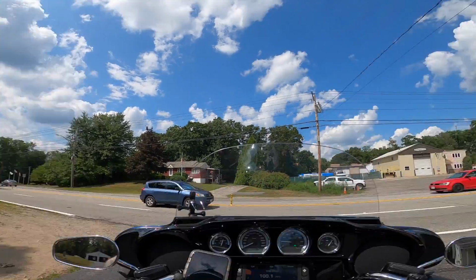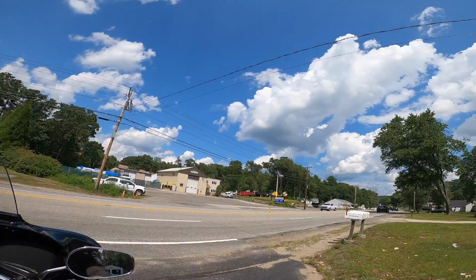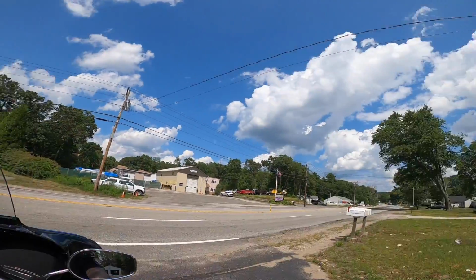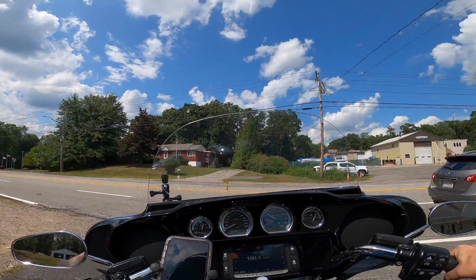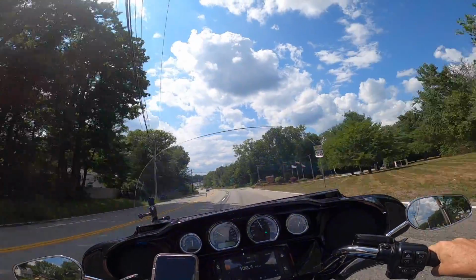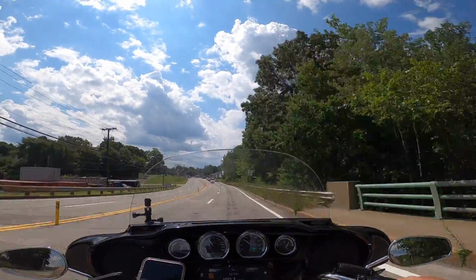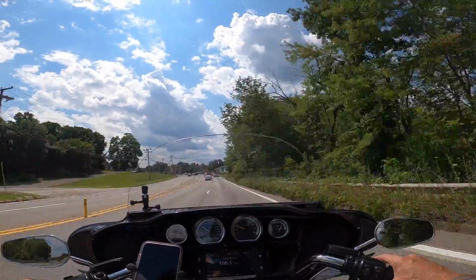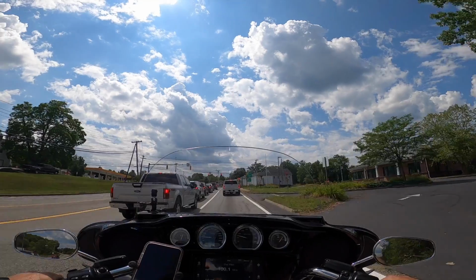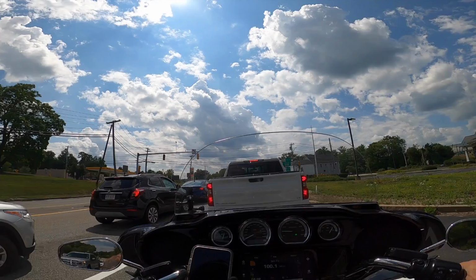Okay, time for our test ride after the installation of the tunable FuelMoto exhaust inserts. I've noticed a decrease in the noise, the exhaust note. It still sounds really good, sounds really throaty, but it's not as loud as it was. And it's going to take a little bit for the target tune function with the Power Vision to make any adjustments it needs to make. And we're just going to take a short ride.